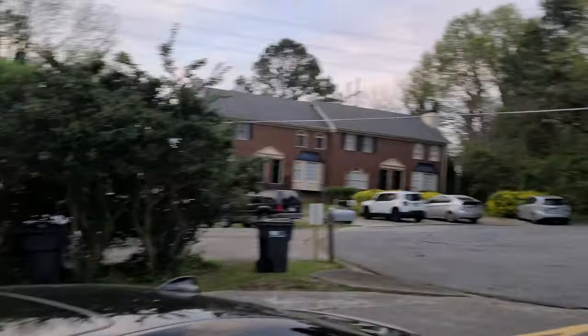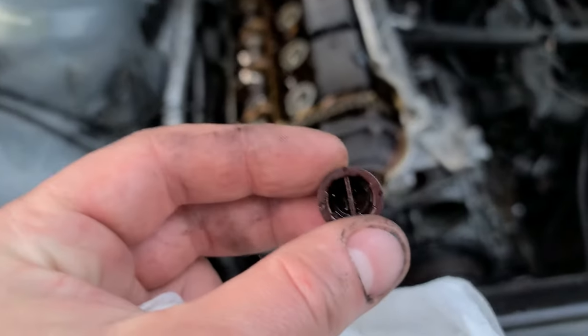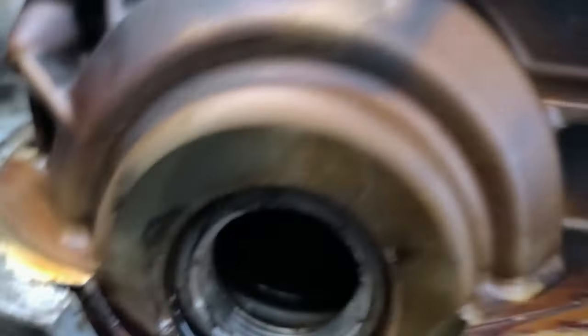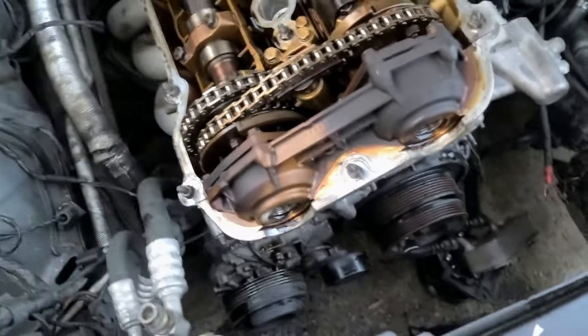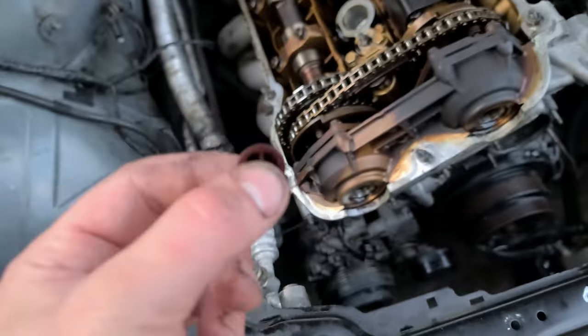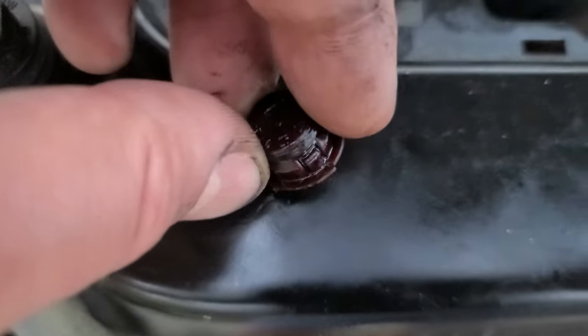Okay, so it's getting dark. It's about 8 o'clock. This is when sunset is. Need to wrap up. But one of these things, which I figure has a gasket, therefore it's an O-ring, is a one time used thing, and they are here. So one I got out, the other one I can't, because this thing is on the way. I don't have time to remove this right now, so I'll try to break that one. Since they are one time use anyways, you should not reinstall these. They will leak. And this one I just extracted, it's already cracked anyhow over there, as you can see.